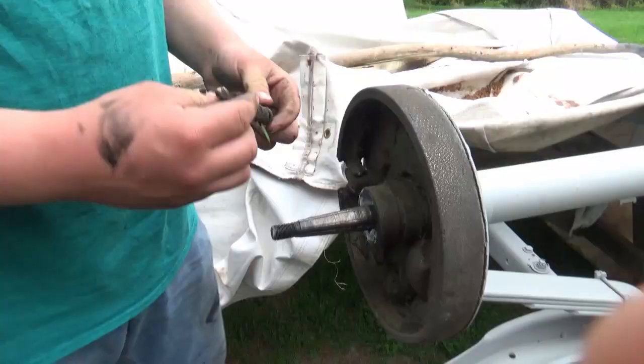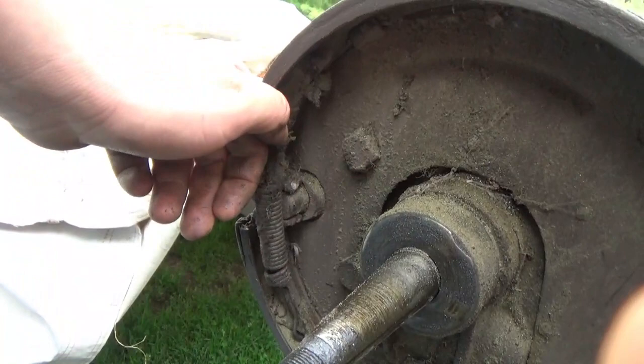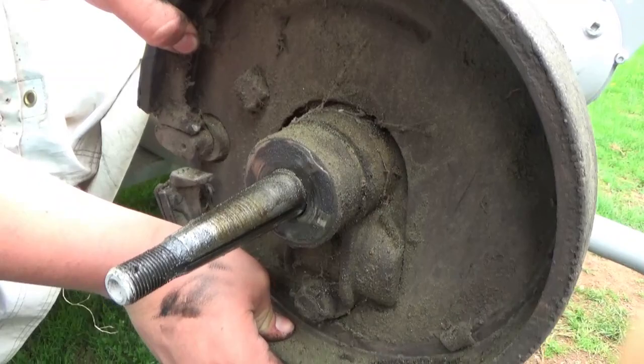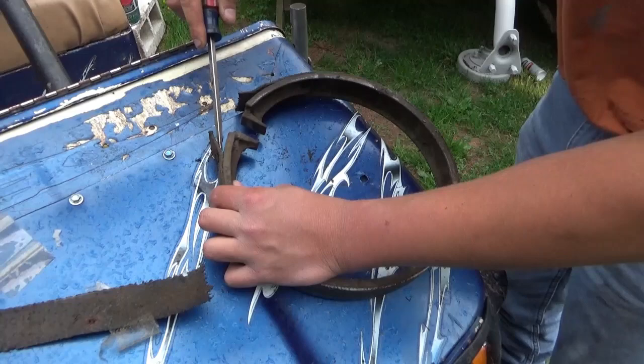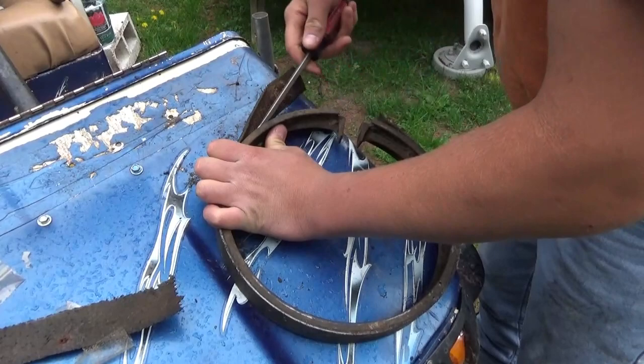All right, guys, we got a new one to these springs, so we bent this one. It's not that big a deal, but all you gotta do is, these are hooked up in here. I just took a screwdriver and basically just wedged it in there, popped it down off there. And then once you get that off, it'll just come off. And then you just kind of pull these apart a little bit to clear these tabs. Just kind of stretch it out a little bit, pop it over that tab, and then you can just pop it off like so. Alrighty, guys, get these old brake pads off, no problem at all. Just get yourself a flat regular head screwdriver, pry it in there, it'll pop it right off the rivets. Don't gotta be gentle with it, we'll just tear it off.